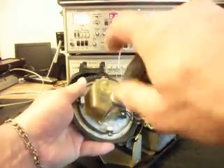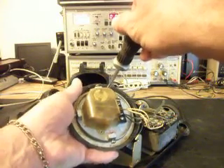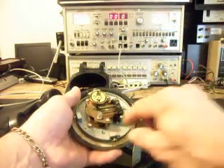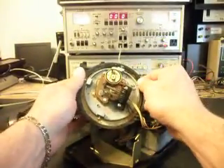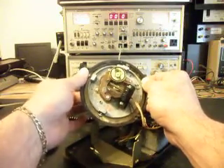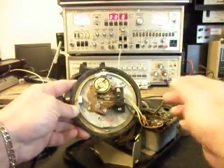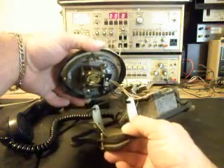Just from spinning the rotary, I can tell the rotary needs to be cleaned up and overhauled a bit — checked out, cleaned up, oiled, and maybe adjusted. It's returning okay, but I can tell there's a little sluggishness in the rotary. They stopped making these actual dials after a while. So we need to go through this, oil it up, and clean the connections.